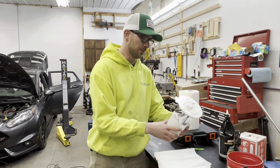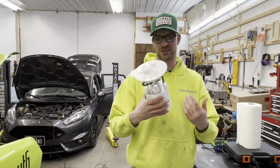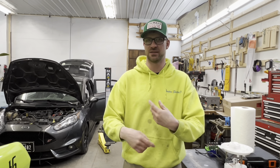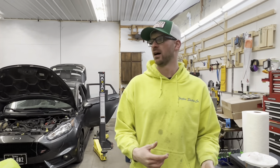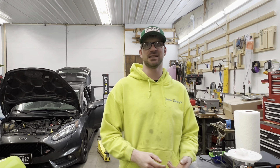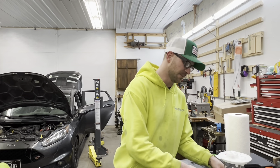Today we have a Fuel Performance upgraded fuel pump. It's a pretty hefty thing — I don't know what this looks like compared to a stock one. Without the high-pressure fuel pump, this probably won't gain me a whole lot of horsepower right now, maybe a little bit. We'll have to get revisions on the tune and everything to see what we can do with it, along with running more boost. Having this fuel pump and having the high-pressure fuel pump, which will hopefully be coming here soon, will allow me to run straight E85, which would be a lot more convenient than mixing E30, E40, E50 like guys normally do. So that's the main goal of it.